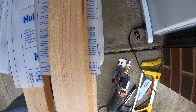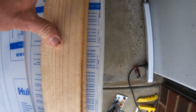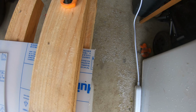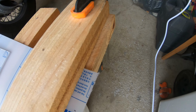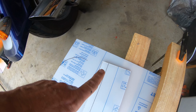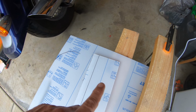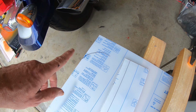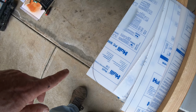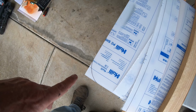Another tip is that if you're using Lexan for a window, to order the UV resistant Lexan. This type will have written on its protective coating which face of the Lexan to have outside, facing the sun. And in my case, I will be using 3mm Lexan, replacing the 3mm glass that was in the cracked window.